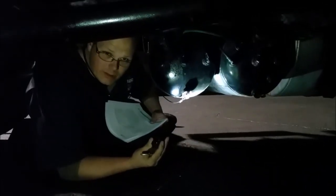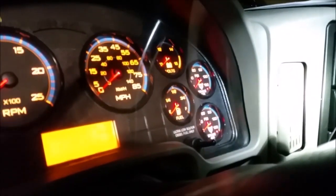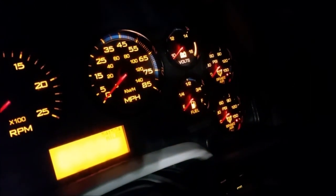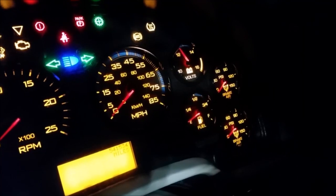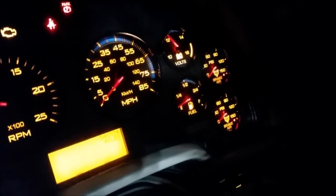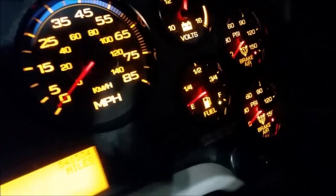Now we're going to go in, start the vehicle, and listen for some of the warnings and audible sounds. We're in the truck looking at the gauges — our tanks are reading zero, meaning there's no air in our tanks. That's what we want when we start up the truck — make sure everything's at zero. That beep is our audible sound for our air saying it's empty.